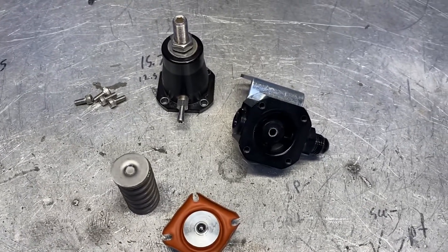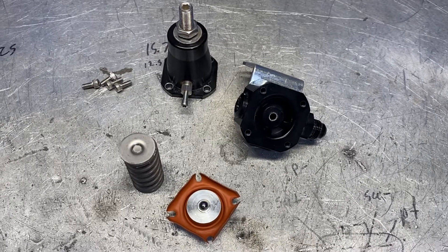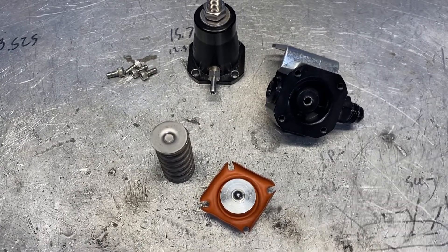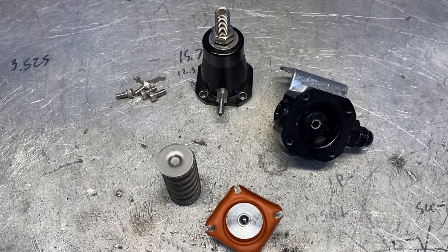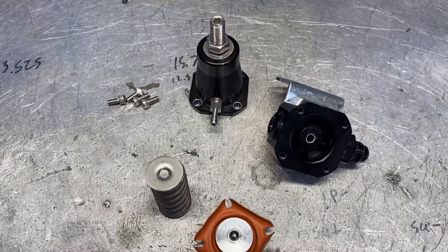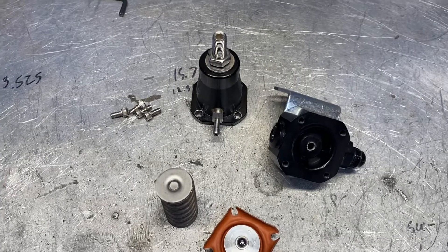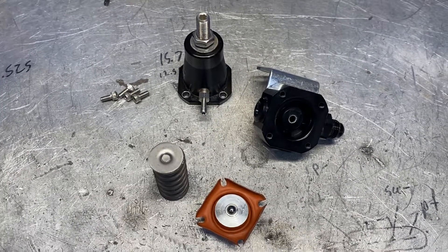That's why these regulators are crucial — though not everybody has to have this setup. A typical application might be a real low pressure turbo setup that you've tuned with a power commander or something. You can tune around the loss of volume coming out of the injector due to intake manifold pressure increase by increasing the injector duty cycle, meaning you're flowing more fuel to maintain the required fuel amount. That does work at low boost. This is more specific for somebody that's going to run more boost — maybe above 10 PSI — and this is where you really start considering a rising rate regulator.